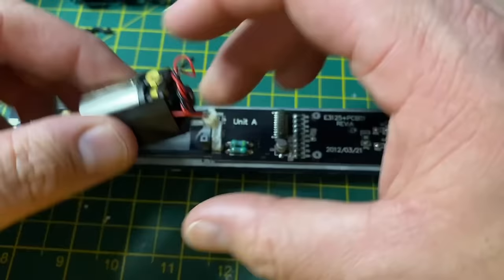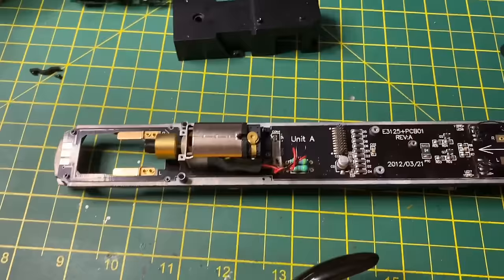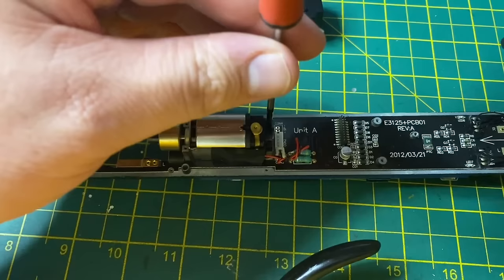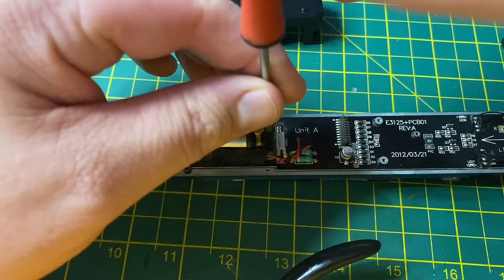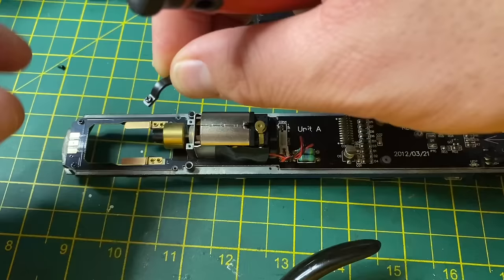And then the two motor retainers are then screwed in place again. Just moving that wire slightly. Whoops, I didn't mean to knock the camera stand there. Apologies for that. So, more fingers and thumbs with this. So yeah, screwing the motor retaining plates back down. These will only go as tight as the hole. The hole is only threaded the length of the screw, so you can't really over tighten these. And then the one on the front was replaced as well.